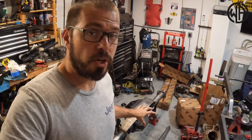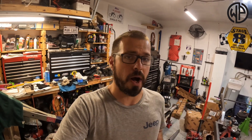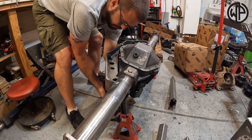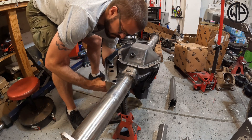Now it's time to put on the second truss. That top truss provides a lot of strength and rigidity to this axle, but putting Artec's backbone truss on the axle is actually going to strengthen it when you hit obstacles at speed in a forward direction and stop the tubes from bending front to back. It does go across the diff cover, so there are some measurements you'll have to take, and depending on your diff cover things may be a little different. Right now we're going to mock it up with the diff cover pointing at the ceiling for a nice flat surface to work on.